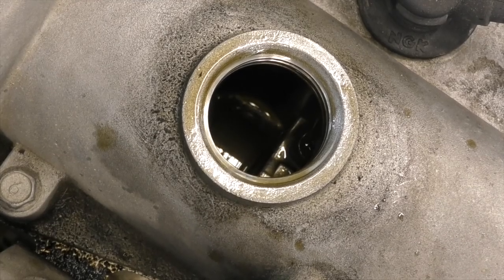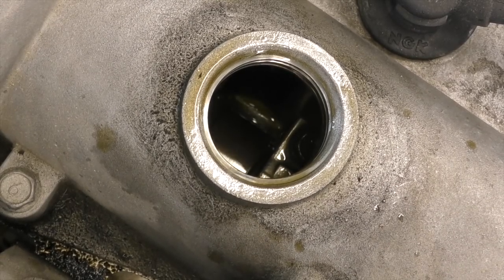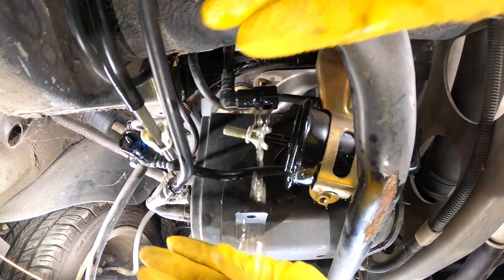I really like to do all the maintenance before I clean anything — you may inadvertently clean something off that would be a really big tell that the car has an issue. If the car has been sitting for an extended period of time, we may want to disconnect the ignition coils or disconnect the fuel injectors so we can crank the car without it starting. When we crank the engine without starting it, we're building up a little bit of oil pressure and circulating oil through the engine at a lower RPM, which can prevent oil starvation.